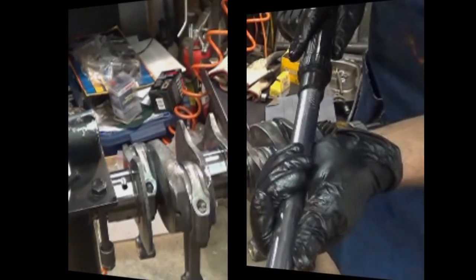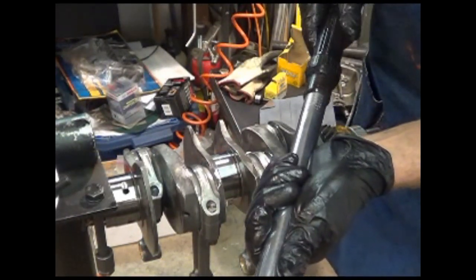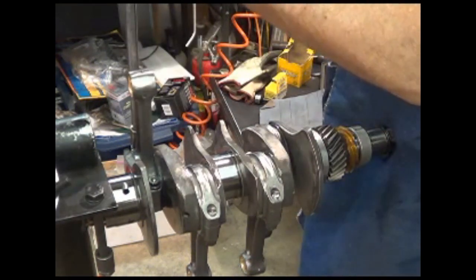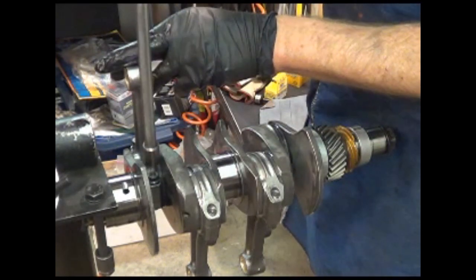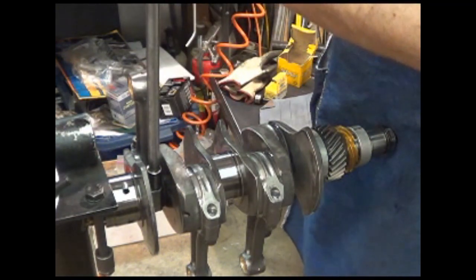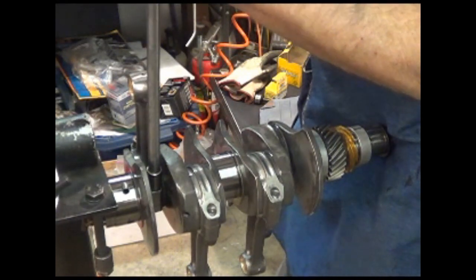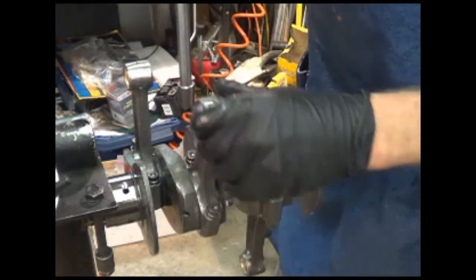Okay, we're going up to our final tightening and I'm going to go to 25. Alright, we're going to make sure everything's happy at each stage. Keep this thing moving — don't stop and start it. And these are hard bolts, so they're not going to give like those case bolts did. See how that barely moved? And that's a good thing.